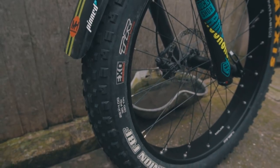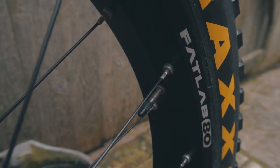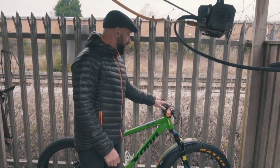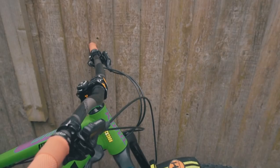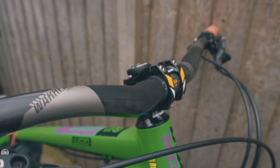The Minion FBF has been a cracking tyre, fitted to different wheels as well. We've got the Fatlab wheels — these were meant to be tubeless but they are proto wheels. We put a few dents in them and that did seem to inhibit their tubeless ability, so we ended up running tubes. Coming up from there, we swapped out Kona's own brand bars — they were a bit narrow in aluminium and had a longer 70mm Kona stem. We've gone for the Nukeproof carbon bars with their Nukeproof 40mm stem, which made for a more comfortable and aggressive ride.